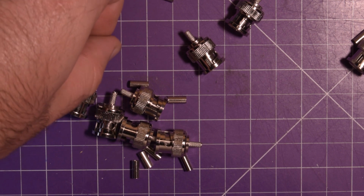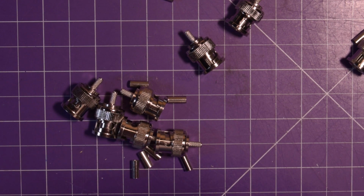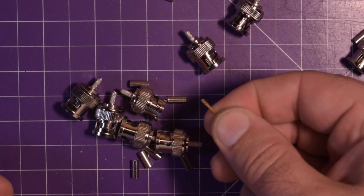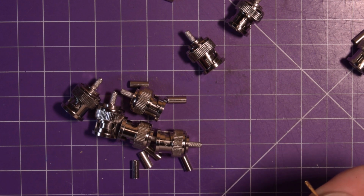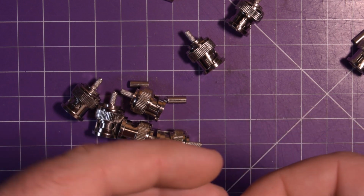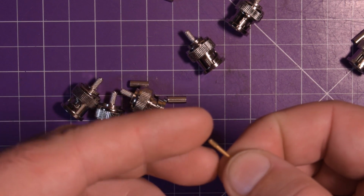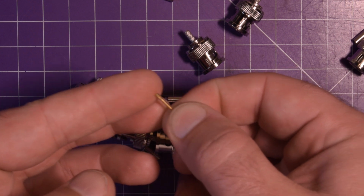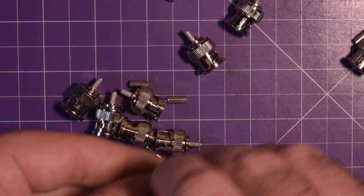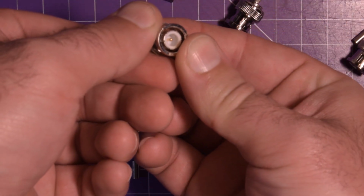But a lot of auto manufacturers, they say soldering is not a valid repair. You must use crimps to ensure a valid repair, because crimps have fewer errors associated with them. So if you're a good solderer, that's good for you. I know I'm pretty good at soldering myself, but manufacturers prefer, actually they demand, that you crimp connections in a lot of cases. But yeah, you see that little pin? It's got a tiny little hole to let the solder go through, and then that'll push into this connector like this. You see, poke out the other end there, and there we go.